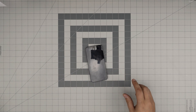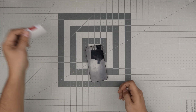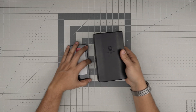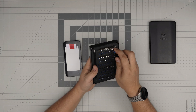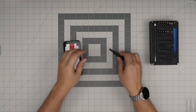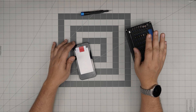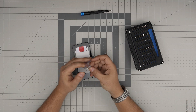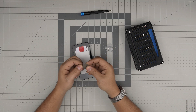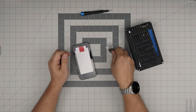Let's go over the tools. Tool number one is a good screwdriver set — I'll be using an iFixit screwdriver set. From this tool set we are going to be using a P2 screwdriver bit. You will also need a suction cup; if you get a kit it will include a suction cup and some tweezers and opening tools. If not, just grab any simple suction cup with a key ring on it. For an opening tool, I'll be using a metallic guitar pick — 0.3 millimeters, soft edges, hard to bend, suitable for opening cases and covers.